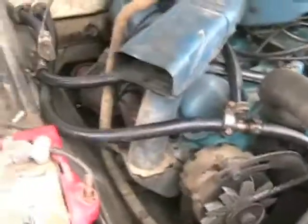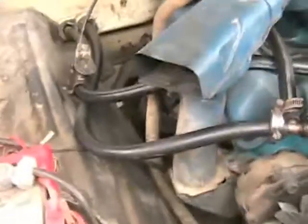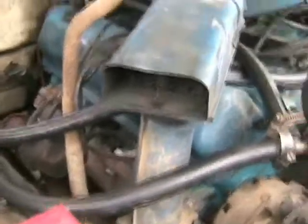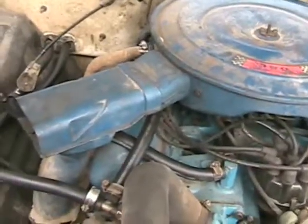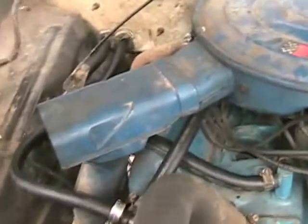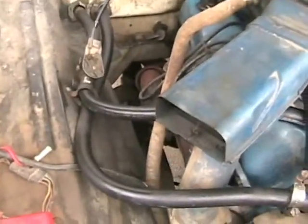This truck has a little flange here that connects from the intake manifold — this is where some of the heat comes in. On the inside of that there is a spring-loaded system, basically a heat spring. It lets hot air in and keeps it closed when there's cold air. Most of the time they work; sometimes they don't. On the newer Ford — a '76 or '79 Ford truck — they have the same system but on the side they have a vacuum modulator that uses engine vacuum to crack that little vent open.